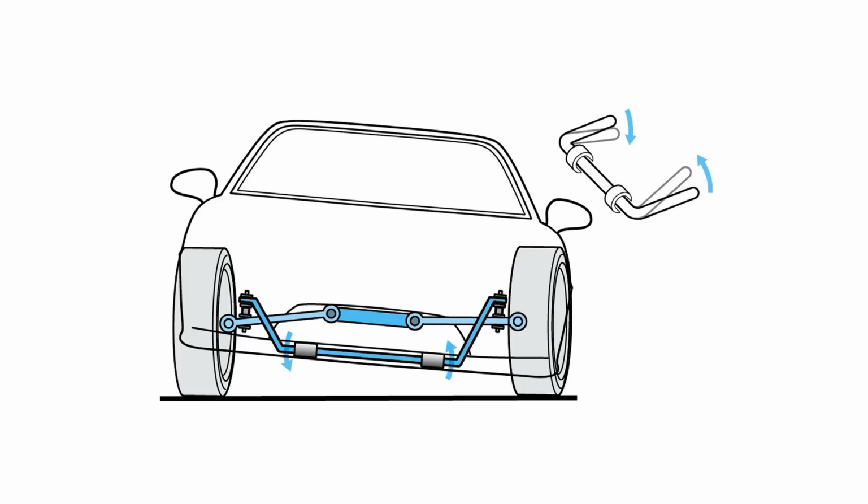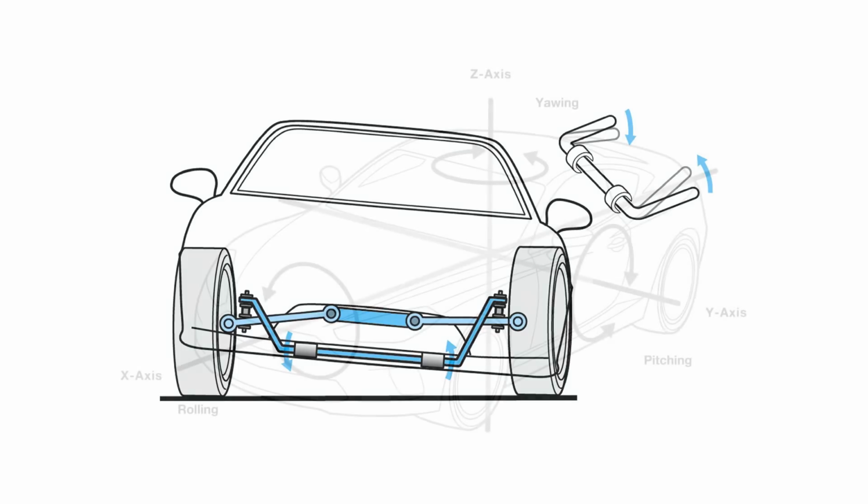They also act like a second spring during cornering. That is, you can use them to increase your effective stiffness at the wheel during cornering without having to increase natural frequencies. This allows you to keep the braking and acceleration grip you desire while also making stiffness adjustments in the corners. Since anti-roll bars come into play with body roll, let's define that first.